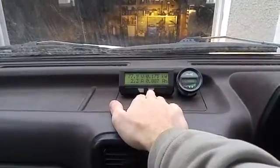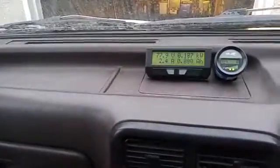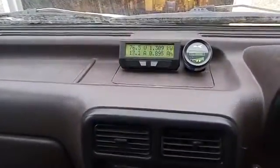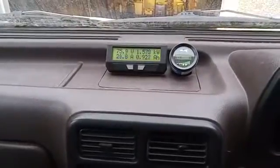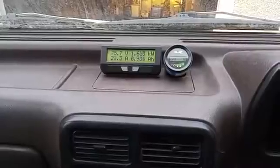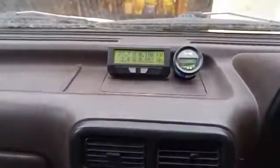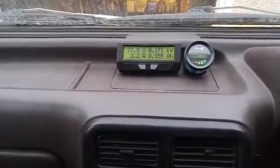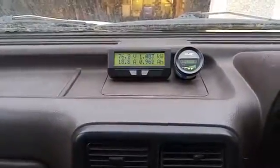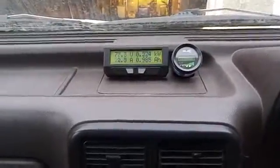So that's headlights on, and sorry, that's 170 watts. Just a minute. There, heater's on. There we go. Once that gets up, about 1600 watts total. So there we go. Turn that off. Turn that off. So if I turn this on, that's the heater switch. If I turn that on, it does not do anything until this fan goes to speed 2. And then you can hear the heater relay click in. There, hear that click out.